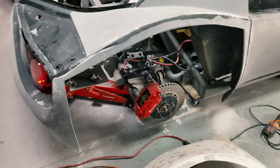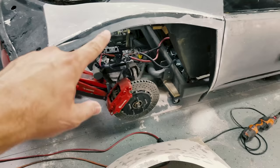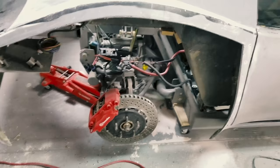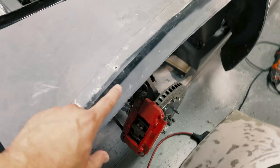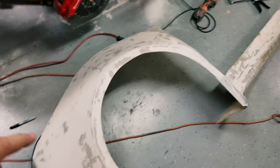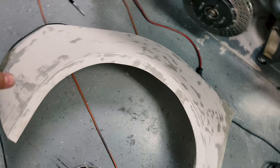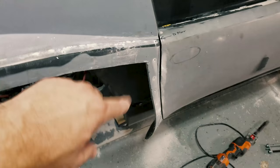I've now cut away the excess pieces I didn't need and cut away the whole rest of the fender — you can see all up inside that area now. The next step is to sand along this line and the top line right where that mark is, follow all of this, and sand the area. On the fender laying down here, I also have to go inside and sand along the surfaces for bonding. Then I need to clean everything up with acetone to get rid of the dust.